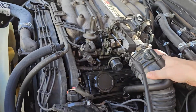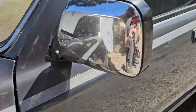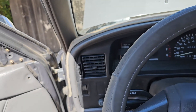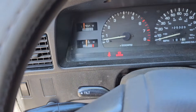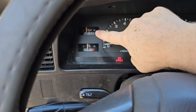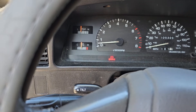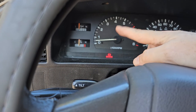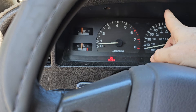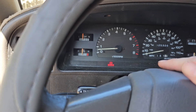The black square tape is now covering that hole. Once we put this back on, you can see a big difference — it's now almost too low, under 500 RPM with a fully warmed-up engine. That tells me my idle air control is not functioning properly, which affects drivability and fuel economy. I need to either find a replacement or fix the one I have. Don't forget to take the tape off when you're done.